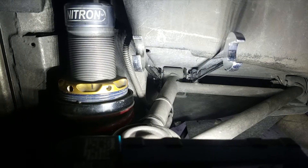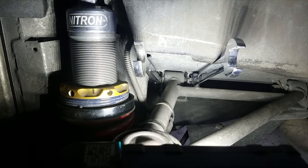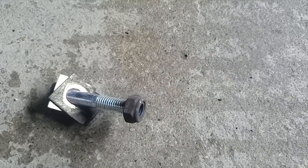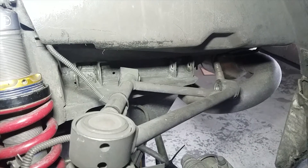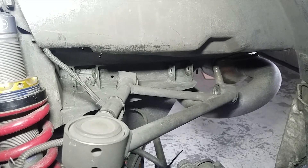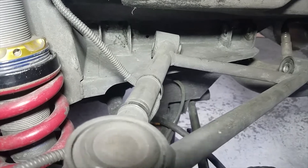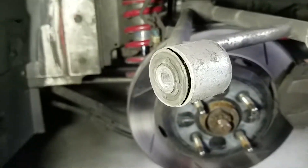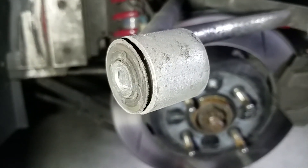I found I could only reliably get two open-end wrenches in there to stay on this bolt for removal. The bolts appear to be in good shape and we can see the nylock feature on the nut at the end. With both bolts out, a little tug and the A-arm pulls right out and can be rotated once we take the zip ties off so we don't pull the wire for the ABS sensor. Here's the look of the rear bushing — it's come partway out of the A-arm.